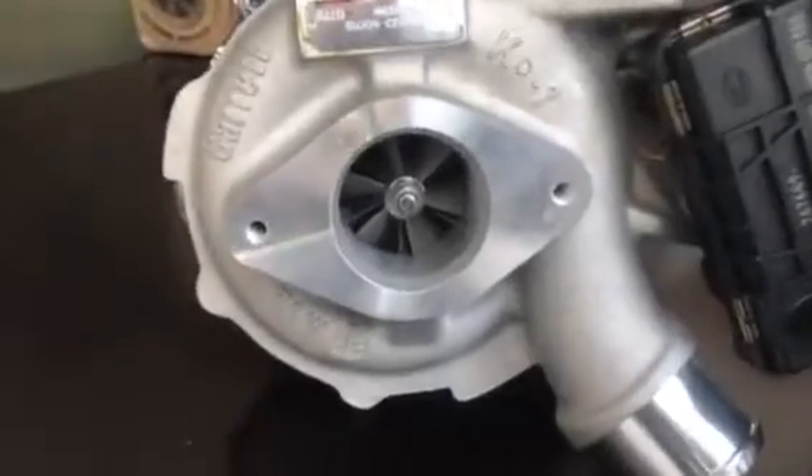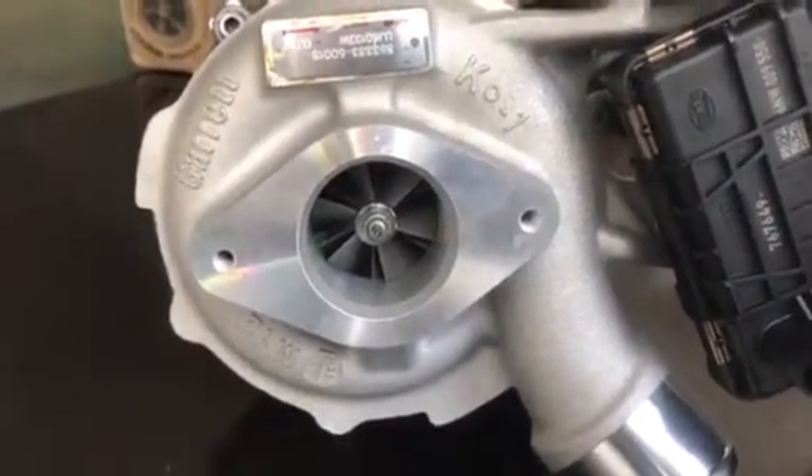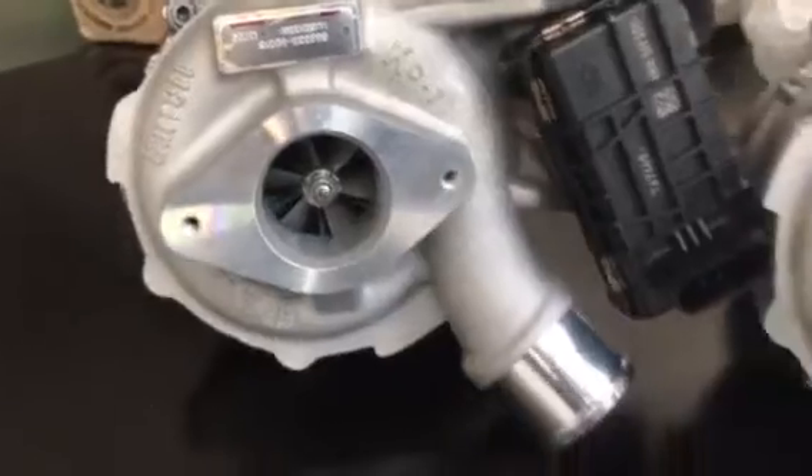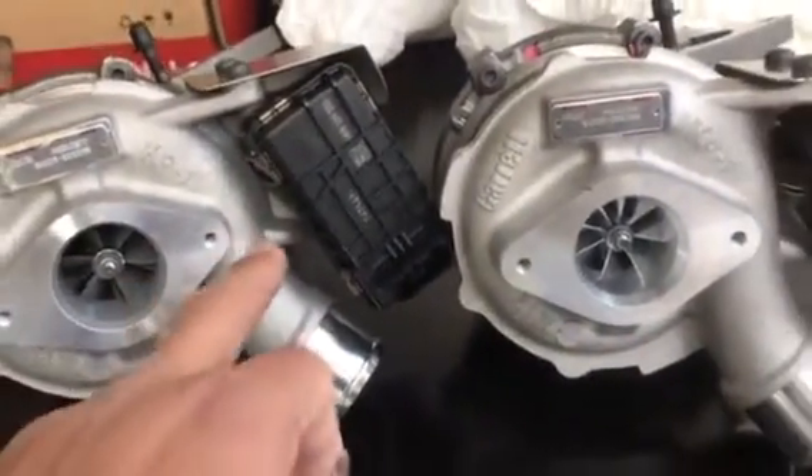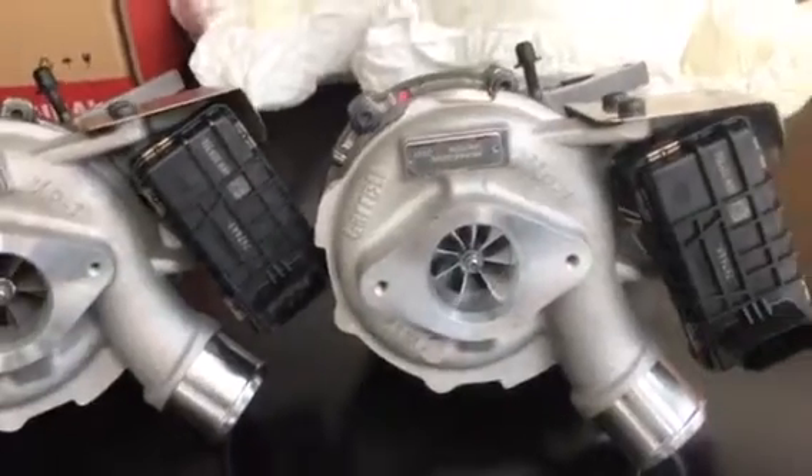Here is a slightly smaller six blade splitter cast compressor wheel on the original turbocharger. Housings are the same, mounting faces are the same, and the REAs are 100% identical.